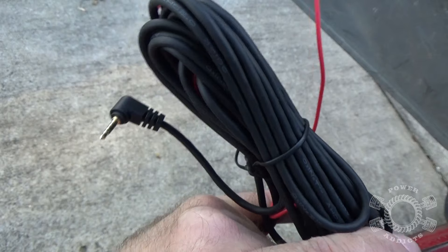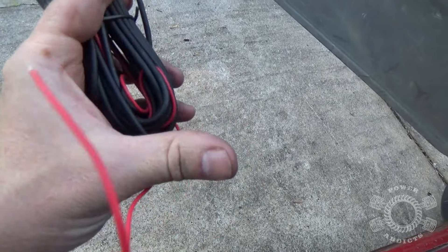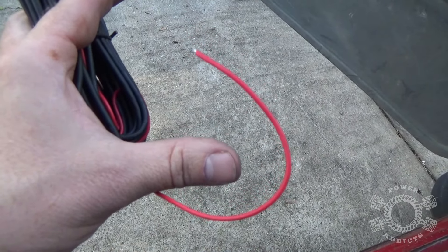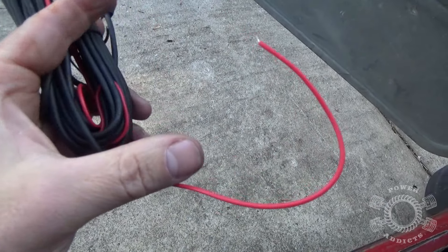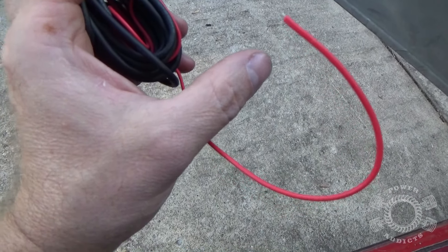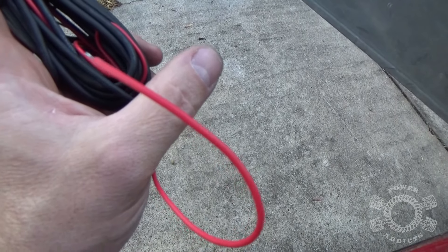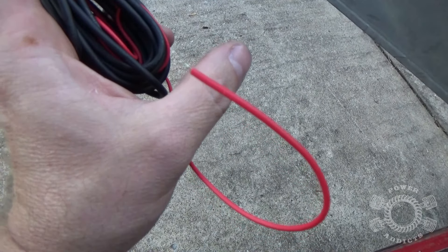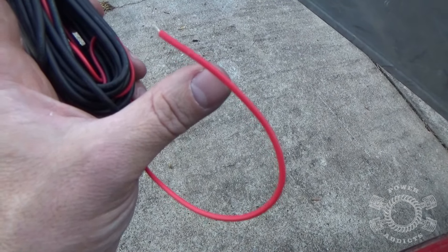Then we'll run this harness toward the back of the Jeep. Now this red wire right here — I'm gonna splice onto that and bring it forward. What that red wire is for is to hook onto your reverse lights. Whenever you put your Jeep in reverse, it powers that wire up to activate your backup camera. What I want to do is manually activate my backup camera for a couple different reasons. I'm mostly putting this one in here as a test bed, because this particular camera does 1080p both front and rear — super high quality video — so when I'm out wheeling I can use the mirror to catch some really good footage.